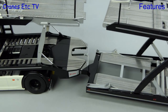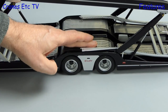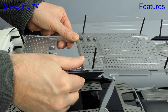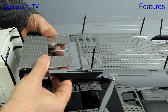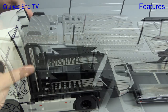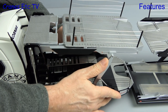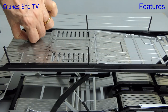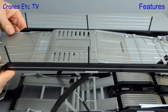The trailer has a full range of movement possible at the pivot point and you just need to make sure you load the cars carefully. There is also springy suspension on the two axles and when you come onto the decks there's a wide range of possibilities. The top deck slides backwards to allow loading and you can also adjust the angle of the front part of the deck so you can get a continuous running surface. There are adjustable screw jacks at the front and you can also lower the angle of the top deck structure. Moving on to the rear trailer section, you can extend it at the front by opening up some wheel holders and the whole front section also slides forwards.